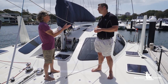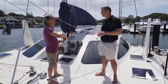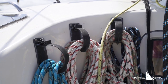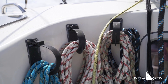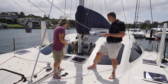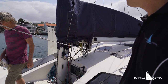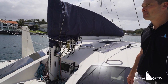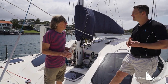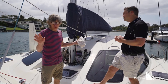I'm not a big fan of sheet bags, so I decided I wanted every rope to have a home. I put snapper hooks all over the boat and every rope has a home, including up on the boom — capacity for every line to have a home. Because when you need to do something like that in a hurry, you don't want to be untangling ropes out of sheet bags. It's the same at the aft end of the boat — all sheet bags have gone.